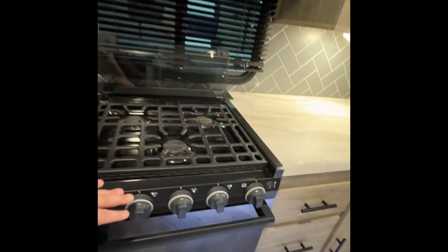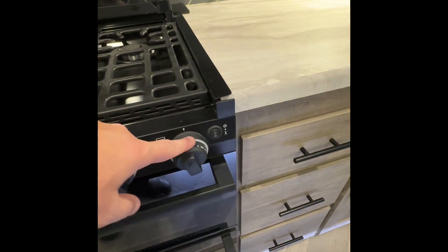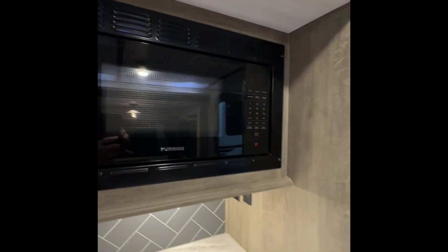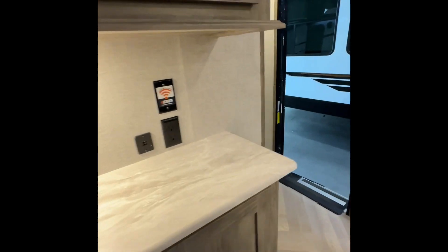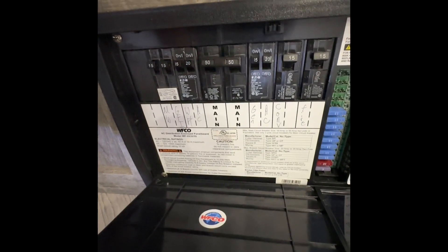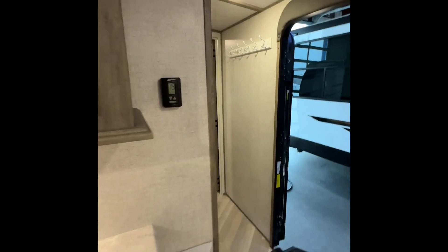Next to that is going to be your three-burner stove top, operated right here with a spark ignition much like you'd have on a grill. Underneath is going to be the oven. The microwave is just like what you have at the house — nothing different except the size is a little bit smaller. The travel lock right here is to open up the fridge, and the fridge runs on 12 volt — right off the battery or when you're plugged in. You have a converter down here that takes the shore power — the AC power — and converts it to 12-volt power so your fridge is always going to run. You can see your breakers right here as well as your 12-volt fuses, all labeled. If something's not working, the first place to check is your fuses as well as your breakers.